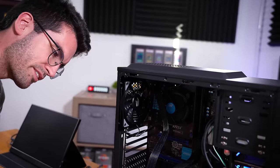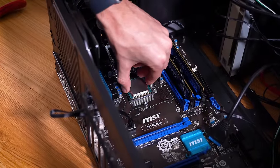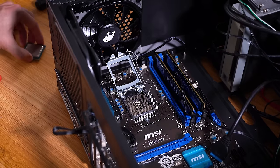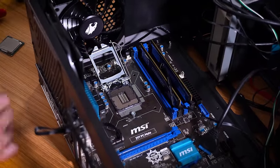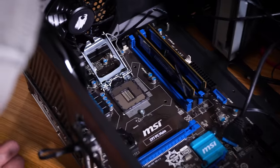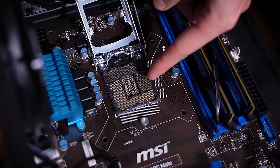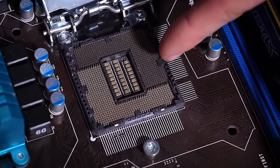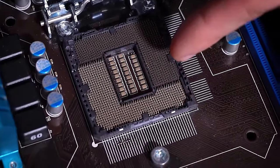It's possibly either the power supply killed the board, or the board killed the power supply — or at least part of it. So this is turning into yet another multi-component rebuild. I'm just curious, because we haven't actually addressed, perhaps, the elephant in the room — the socket. The chip itself looks okay. The socket though — there's like pins touching other pins. Right here on the right inside of the socket, you can see there are two or three pins that are bent. That definitely could explain why we're seeing some weird behavior from this platform.